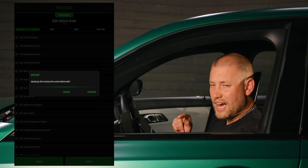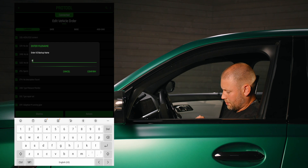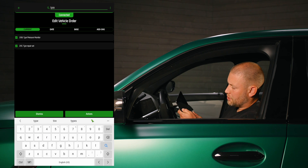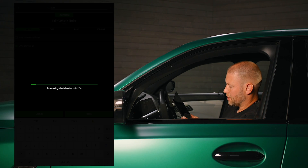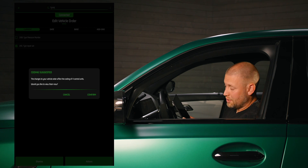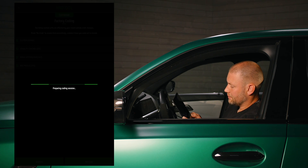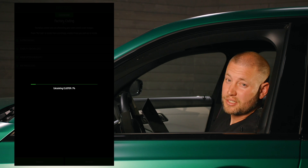Here is my entire build. Go to the bottom right where it says 'Edit.' Whenever it asks you for a backup, I always highly suggest doing this just in case anything gets goofy — you can always revert. I like to put the date in as my backup name. Once you're at that screen, type in 'tyre' and you're going to uncheck '2vb' where it says 'Tire Pressure Monitor.' Just uncheck that, and then at the bottom hit 'Actions' and save it. It's going to determine what needs to be coded in the car and automate the process, which makes it super simple. It shows four control units to code — hit 'Confirm' then 'Recode.' You might see your cluster and screen go off and on again — totally normal, just takes a couple minutes.